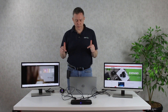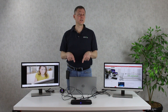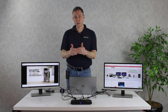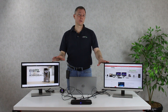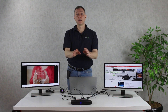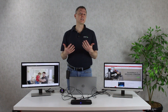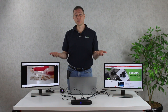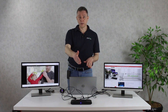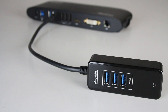So how is this working? How are we able to, through just a single USB cable, get two extra monitors in addition to whatever your Windows laptop or Chromebook can already do? The way this works is it's transferring only the pixels that are changing on these two screens over the USB cable to the docking station, and then the docking station is refreshing both of these monitors. It's able to add as many as six additional virtual displays if you add some extra adapters on top — all through a single USB cable to the dock, which supports two and then has extra USB ports to potentially support more.